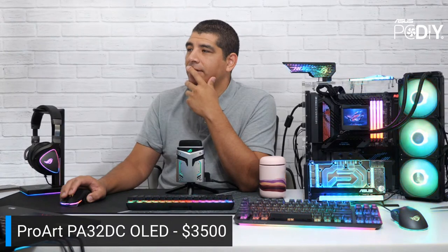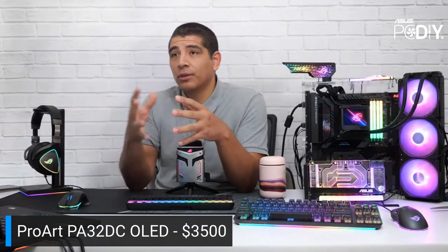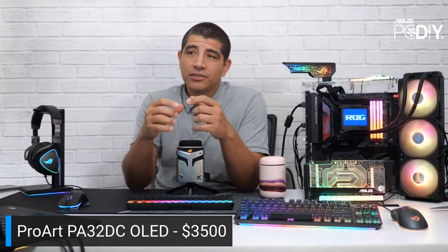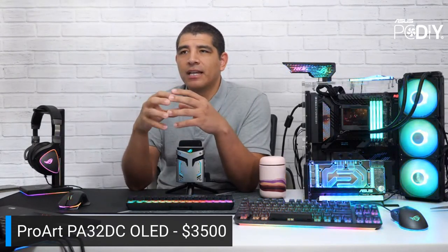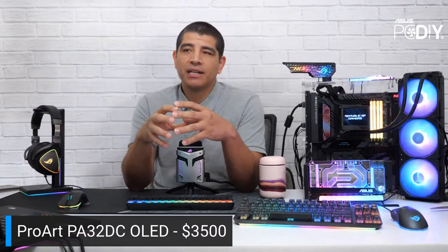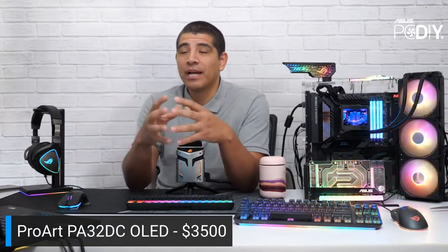Okay. I thought I had a slide saved here that talked about the difference in terms of the OLED. But as I noted, with WOLED versus traditional OLED, the main difference is that this is a pure OLED, so it's just RGB with no white subpixel. The big benefit is that the brighter the monitor gets, the white subpixel can actually affect the overall rendering performance for the colors. Not having that present allows us to maintain better color accuracy, which is part of the reason why the monitor is so color accurate out of the box, with a delta E below one, which is really, really high grade.